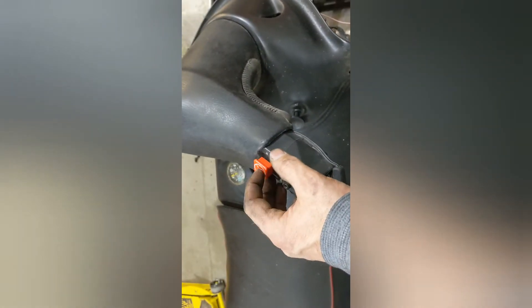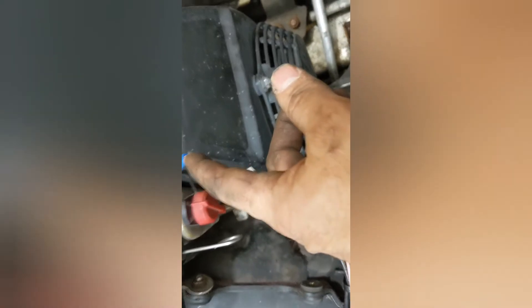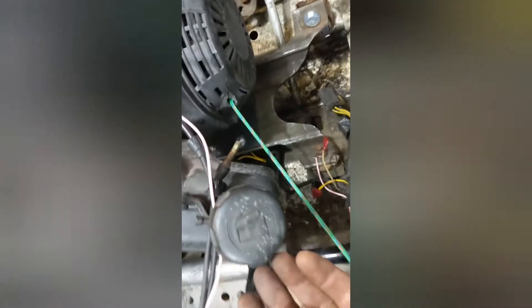On the other side, I was able to re-cord and graft in the stock location for the pull handle. I was also able to wire in the stock kill switch into the kill switch that came on this motor. I was able to maintain the stock throttle by hooking it directly into the governor.